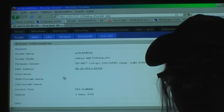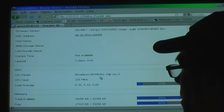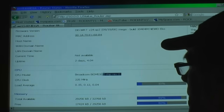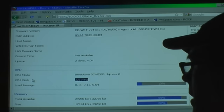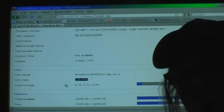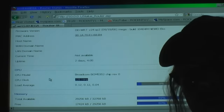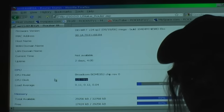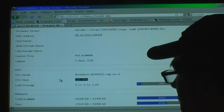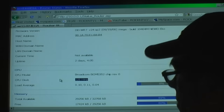I'm just here to show you that I've been running this one for a year. Mine is running — the Broadcom chip name is right here, hopefully you guys can see that. The megahertz and the CPU clock is 225; stock it's 200 megahertz. Some of the later versions of the Linksys G-Routers have been using 216 stock from the factory as the standard frequency of the CPU for this router.